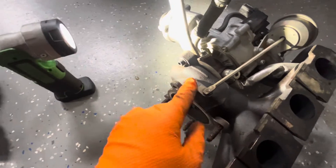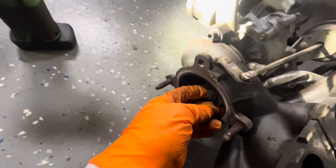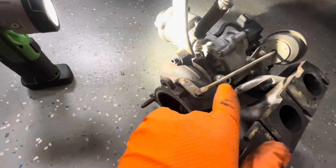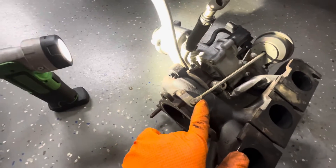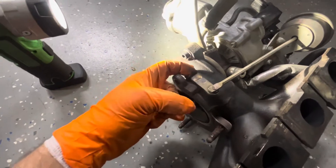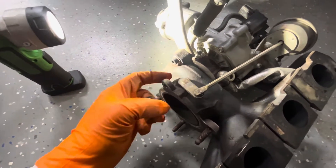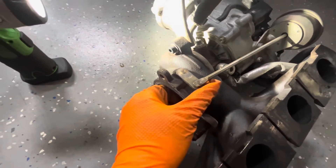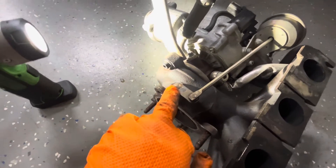If you're feeling adventurous, you can grind this off, pull this straight through, and slide the new one in with the new arm. Attach it to the wastegate, or replace the actuator as well, depending on how that all looks. Make sure this is clocked correctly — you have to drill out the housing for a new bushing, make sure this is all assembled in place. This door has some pressure on it, and this needs to be positioned correctly before you weld it back into place again.